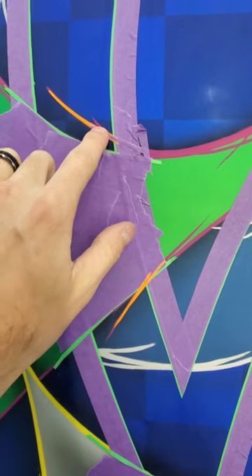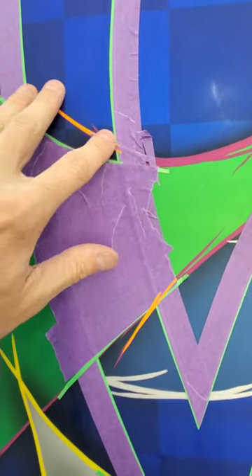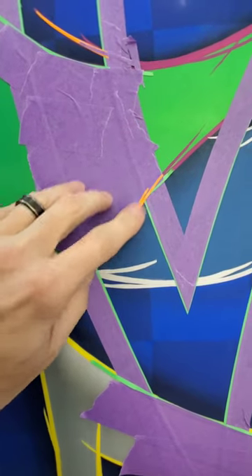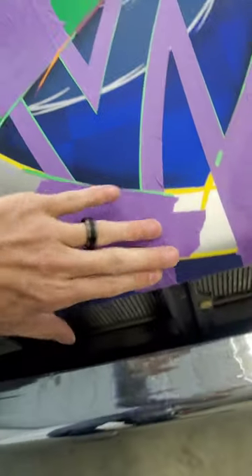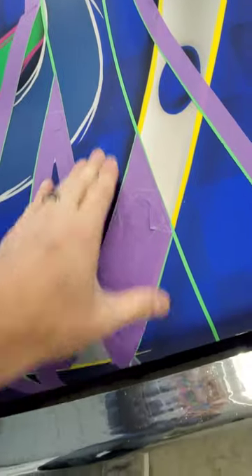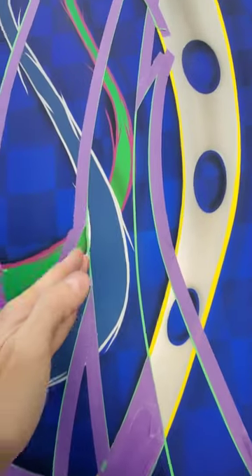I went through and refined my fine line tape — some of it was looking a bit off, so I fixed it, because this is all going to get paint. All the extra stuff gets covered up when we spray the silver. This is the time to go back through and fine line everything I want to fix. The graphic comes back down, comes back up, disappears — everything gets silver. This other graphic is going to be a different color, kind of a baby blue teal, with a pinstripe riding on top. We chose a straight red for the pinstripe on the big graphic.